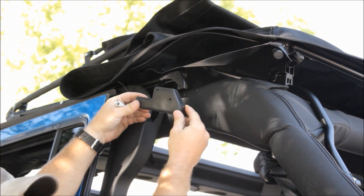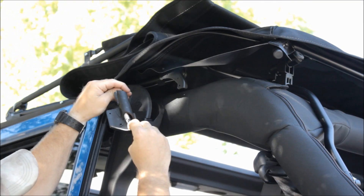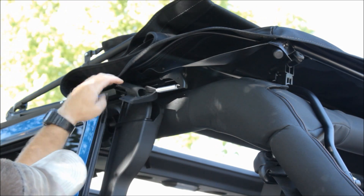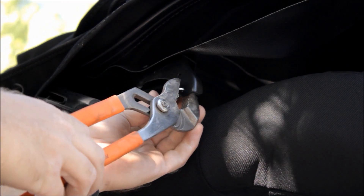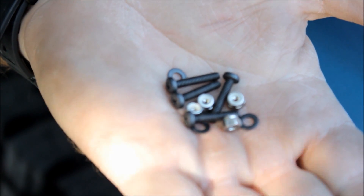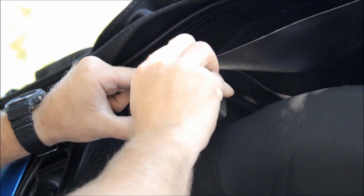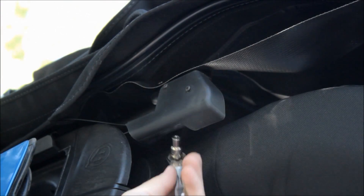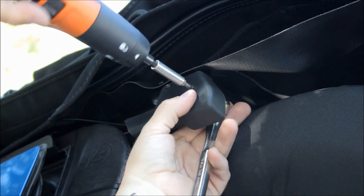Fold the front of the top back, then grab the cable pocket and slide the cable spring through it. Slide the cable pocket up the cable a bit out of the way, then hook the spring through the hole in the bottom of the number three bow corner. Using pliers, crimp the end of the hook on the spring so it can't come back out. Then use the small machine screws and lock nuts to attach the cable pockets to the number three bow assembly, protecting the top from the spring and any sharp edges. It's easiest to put a socket on the back side and use an electric screwdriver.